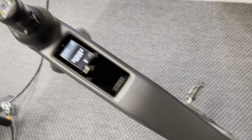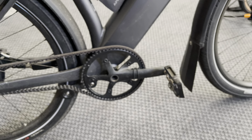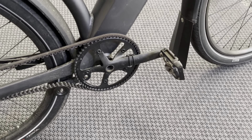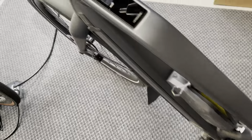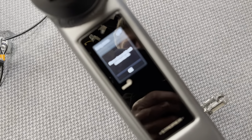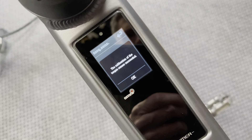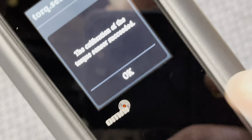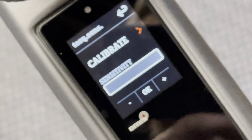Click on Sensor and then click on Calibrate. At that point, just pause for one second — make sure that your crank arm is in the forward position and that there's no stress whatsoever on the pedal. You can't be sitting on the bike with your feet on the pedals — absolutely no pressure on there. Then just click the okay button. As you can see, it now says 'Calibration of the torque sensor succeeded.' Click okay and that's all done.